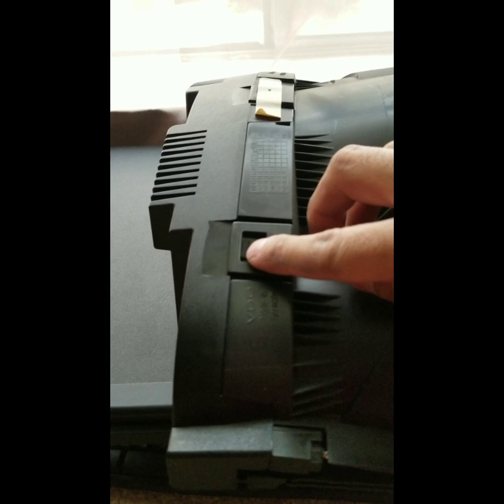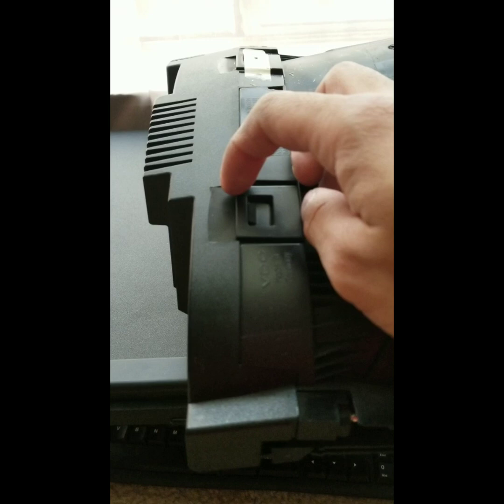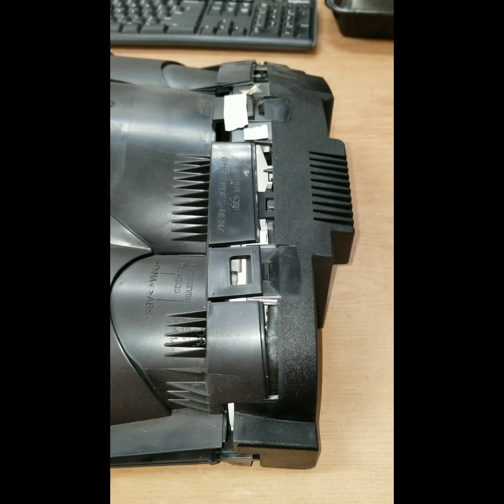Getting to the LCD piece may take some time, but all it is is these little tabs held by security tape, which has disintegrated. You can use a pry tool — I recommend a nylon pry tool so it won't scratch the plastic; it's the correct tool for this job. No screwdrivers or other tools are needed. This cluster is pretty standard, not complex. I believe there are three tabs on top and two on the bottom.